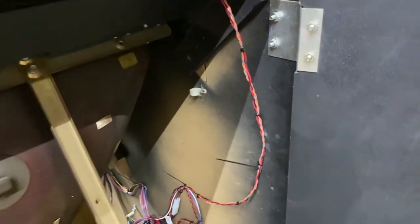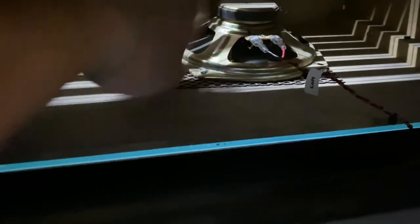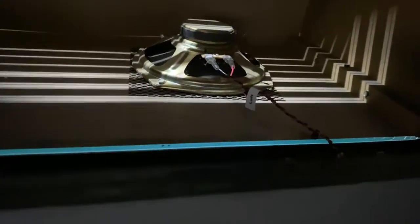In the back I ended up buttoning down most of the wiring. For the speaker wires, a little trick I do — on the left side of the speaker where the black wire was, I take a sharpie and make a little black mark so I can see it easily from where I'm working. Normally there's red sharpie around the terminal but it's hard to see, so just mark somewhere visible so you know the black wire. The polarity is important — before, when they had the blacks tied together and were running one speaker reversed, that was completely wrong.